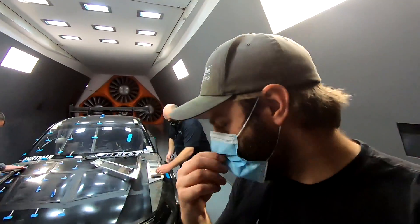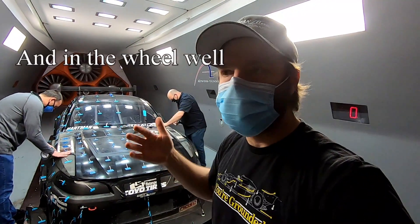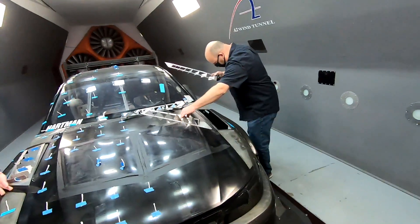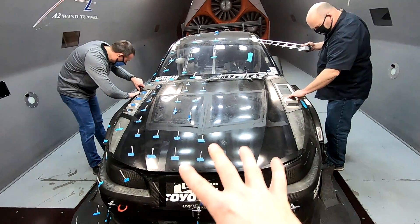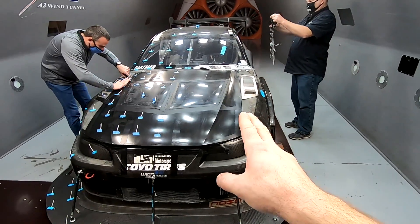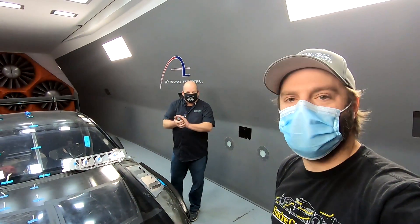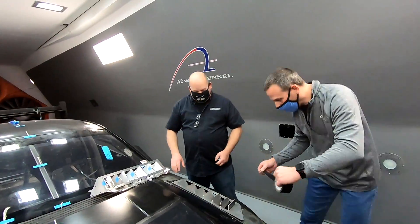Al has pressure probes on the front and rear of the radiator to measure the pressure drop across the radiator, which tells us a whole bunch. The pressure difference between front and rear indicates increased or decreased cooling capacity. But with the splitter and the tunnels, the louvers are kind of helping the splitter make a little more downforce instead of the gains coming purely from the radiator. It's all about the things working together.